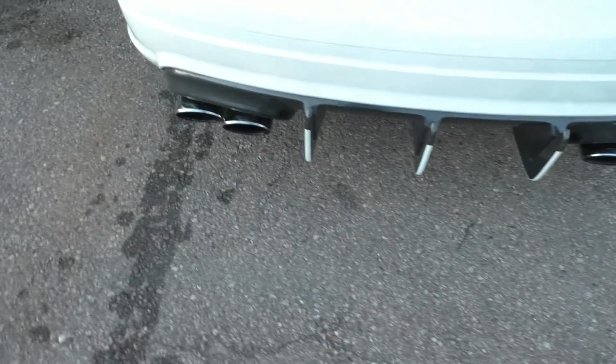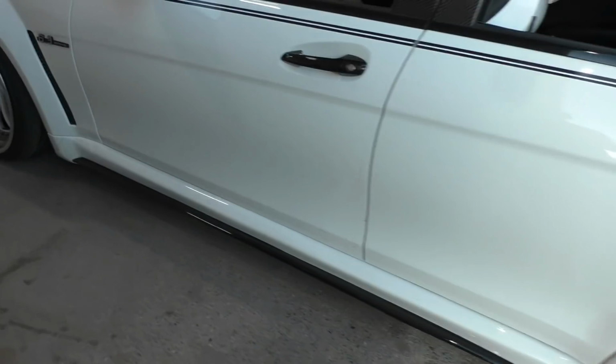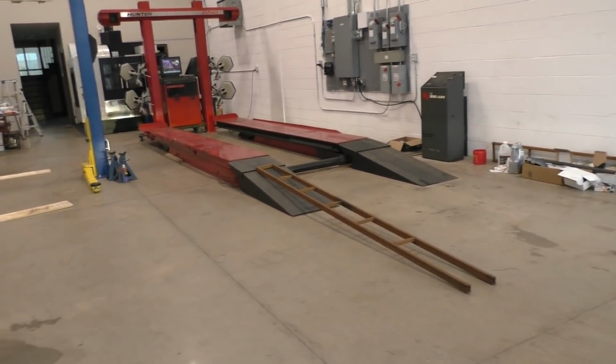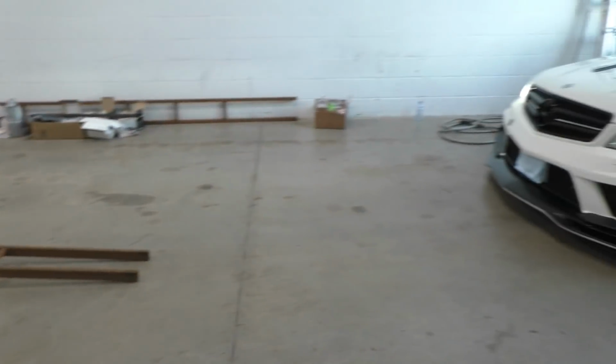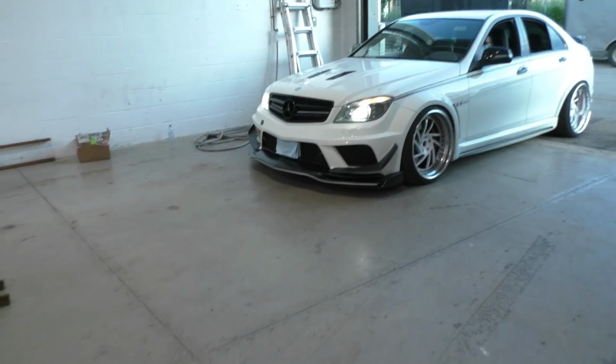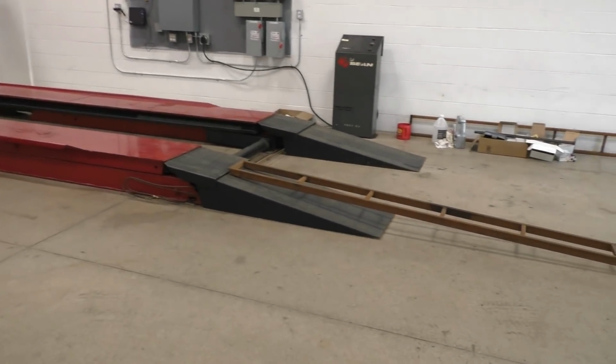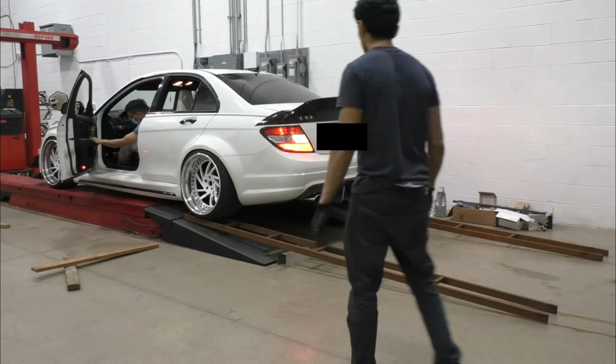It's surprising how big of a difference that made, just preventing the exhaust from touching the chassis, and also moving back to the factory transmission mount. Now I just got to put it on the alignment lift quickly and do a quick alignment, because when the steering rack was removed it did not sit back in its proper place, so the steering wheel is not centered anymore, it's a little off center. So we just got to fix that and then the car should be good to go.